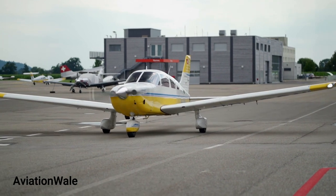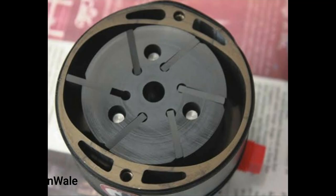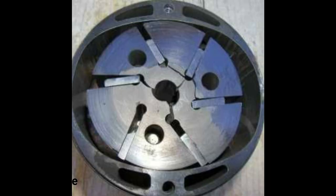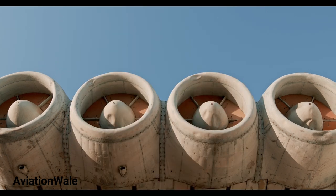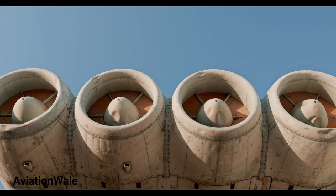The very first advantage is there is no pump to break. Today's aircraft use a vacuum pump and these pumps are prone to breakage, whereas in the venturi there are no moving parts to break. Second, these pumps are expensive and the venturi is cheaper by comparison.